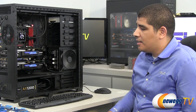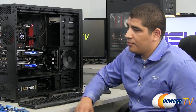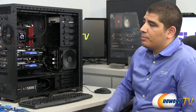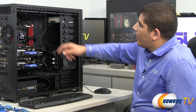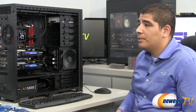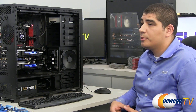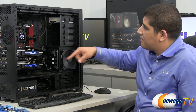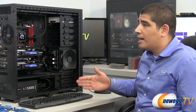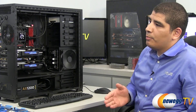Same thing as if we were first setting up the system — this is a nice time saver in that you wouldn't have to worry about potentially having to re-access the socket, potentially damage any pins inside the socket, or add memory or other components. You could have just directly gone this route. We can see our debug LED has fixed at 70, which is actually a memory code initialization. That's because this update included an MRC update from Intel, which is updating some of the parameters for how the CPU interacts with the DRAM, affecting some performance parameters as well as other variables. Now it's cycled through that and it's continuing forward.